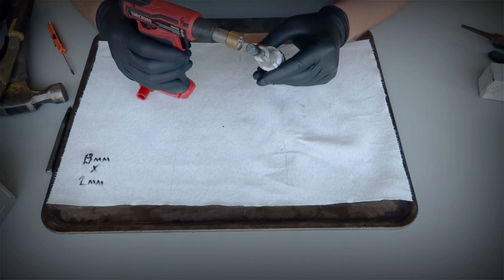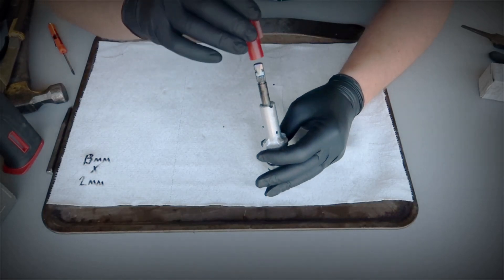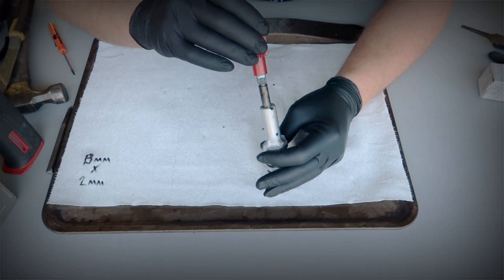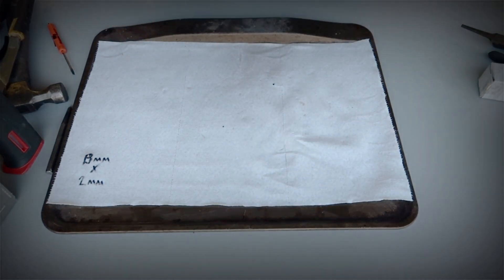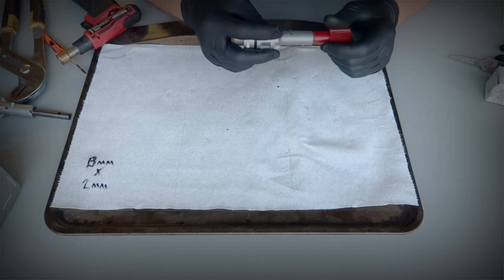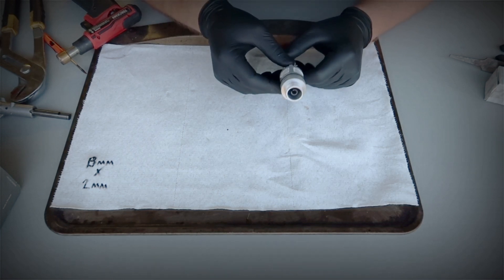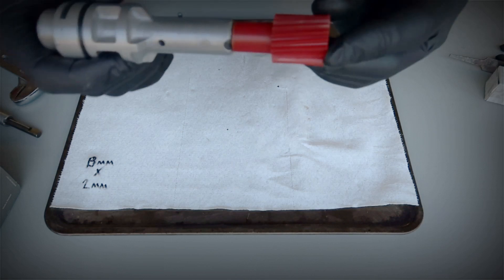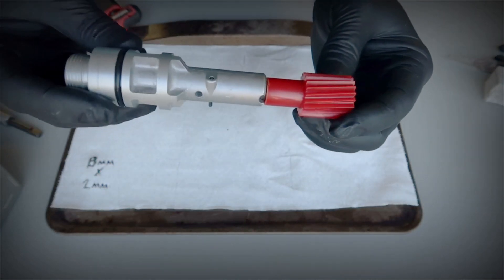You're going to start seeing the shaft turn close to a neochrome or burnt titanium look — that's when you know you've got it hot enough. Don't forget there are bearings that the shaft rides on inside the housing, so be careful getting it that hot. But you want it hot enough that you can slide the wheel on. Go ahead and slide that new wheel on all the way up to the point where the end of the red cog is flush with the end of the shaft — that's when you know you've gone far enough. And there it is — your new speed sensor.